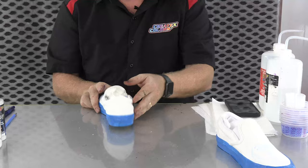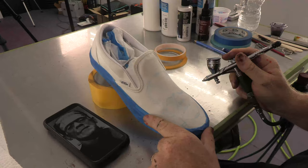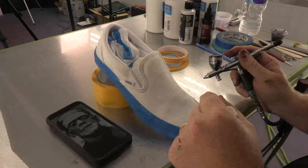Okay, now I'm going to go ahead and try this little PS771 by Spray Gunner. And I've got it loaded up with my color, which was a combination of black candy and Tim Gore's Vascular Violet 1:1, and then the UVLS 4050 with some 4011 reducer.